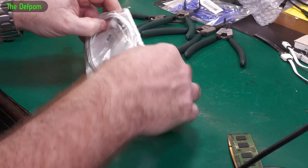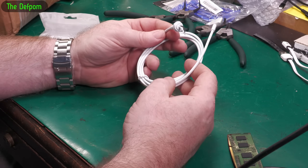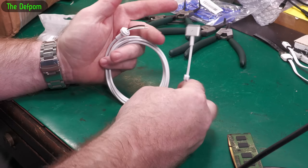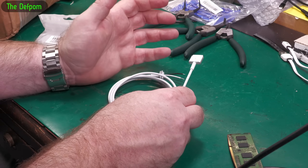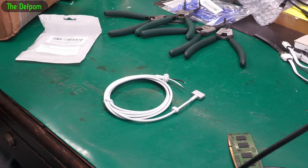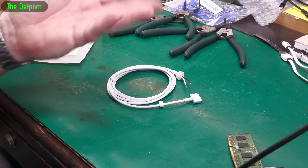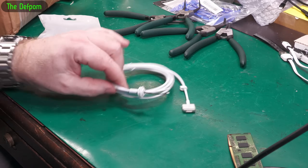Well that's a MagSafe cable. I've been repairing a bunch of MacBooks recently and doing videos about that as well. A lot of them just need a bit of refurbishing and care and they're alright - some actually do need repair. I've repaired some already, I think I've got 5 left to fix, some with serious issues. But I didn't have a MagSafe 2 cable which I've been putting in my power supply. It's really useful to have a MagSafe 2 which you can run out of a power supply to monitor the current going into the unit. If you're trying to diagnose it, knowing how much current is being consumed gives you clues. You can see it cycling or pulsing up and down - if you see it pulsing you've probably got a short somewhere on the board and it's trying to power up and protecting itself and shutting back down again. You can't see that if you're using an external charger, but you can if you're using something like this.